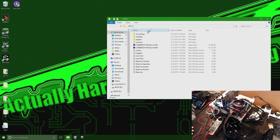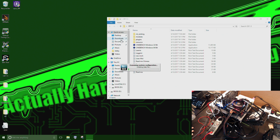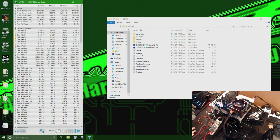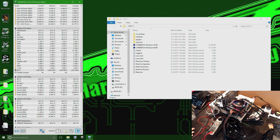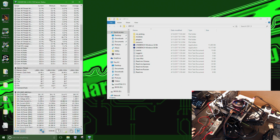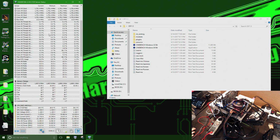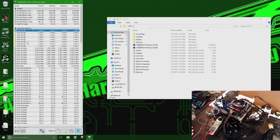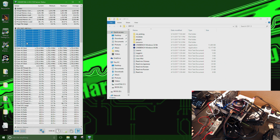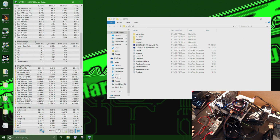For monitoring Ryzen CPUs, I really recommend using just HWiNFO64, the latest version, because you do get basically all the readings you need. It varies motherboard to motherboard where you'll find the readings, but all the information is always somewhere in this giant list of sensors. First things first, these voltages, just completely ignore them. They're just the VID. They literally don't mean anything. What you actually want to look at for voltage is this right here, CPU core voltage SVI2. That is the report from the actual voltage controller on the motherboard. That's what the voltage controller says the CPU is getting.